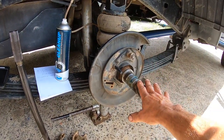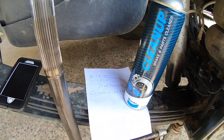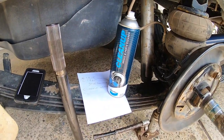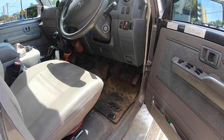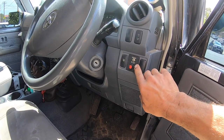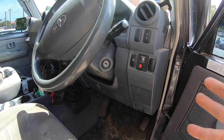It's telling me there's something wrong with the right rear — a C1415 — and also a C1425, which is a stop switch open circuit. The stop switch open circuit we've worked out: I blew a fuse on the last trip towing the caravan down to the Dewa River. I blew a fuse on the Red Arc, so for that night I didn't have any trailer brakes, which I wasn't really aware of.